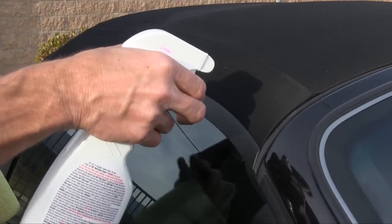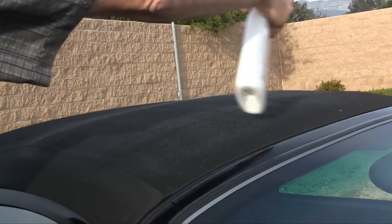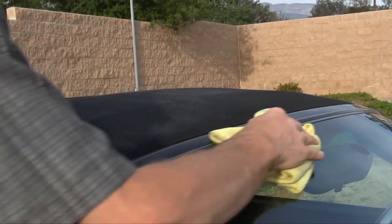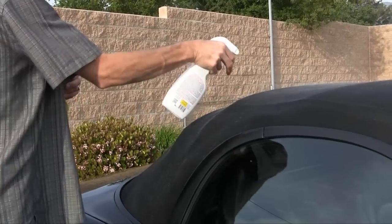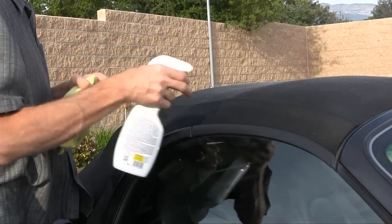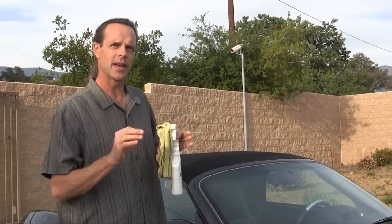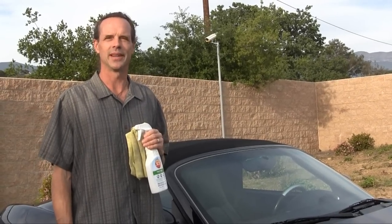When you do the application, you want to use overlapping strokes, applying it so that it's noticeably wet. I'm going to make sure that I take any excess spray off right away as per the directions of the 303. I tend to put a little extra on the seam, so I'll run this down one more time just on that seam. You're going to do that for the entire top — that's going to need 6 to 12 hours of drying time, and in that time you have to make sure there's no moisture possible that's going to get on that surface. I apply this every six months and it seems to do a great job on keeping the top protected and very water resistant. I'm Greg, your car angel — thanks for watching, I'll see you in the next video, take care.